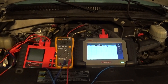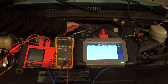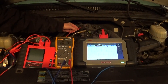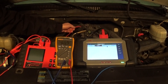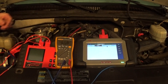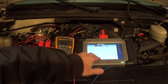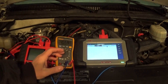If I touch my lead to ground, it's just going to go to ground. If I touch the 5-volt reference, it's just going to reach 5 volts. To me, it looks like a pretty safe way to test the circuit because I'm not going to damage anything. I'm comparing the voltage on my voltmeter and the voltage on my scan tool, looking for any voltage drop.